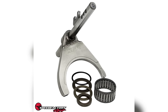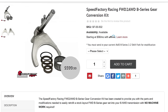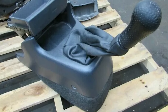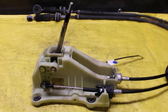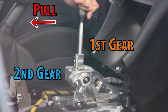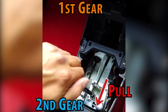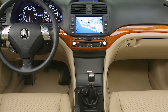There is an aftermarket option that will allow you to swap any B series gears like those from the LS, SI, GSR or Type R into the all wheel drive transmission case. As far as the shifter, you'll need to get the CRV shifter and cables. There is also the option of a K to B shifter — you'll need a TSX shift box, DNA shift bracket and 2006 to 2011 Civic SI cables, or you can just buy the K-tuned K to B all wheel drive kit. The TSX uses a pull push pattern going into first then second like the B series CRV, so that's why the TSX would work. The RSX uses a push pull type which will make everything backwards, so I'd get the CRV or nicer looking and better shifting TSX option.